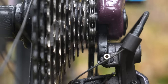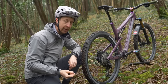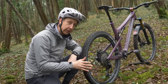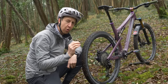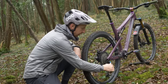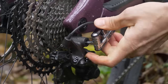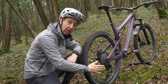That's a good gauge of reference without having to have expensive workshop tools. If it is bent, you will need to bend it back. If you're unsure about this, definitely take it to a bike shop or someone that has a derailleur alignment gauge, especially the tool for doing this. But if you want to do it yourself, an adjustable spanner with the derailleur removed — you can straighten these back, but go very easy on it because you don't want to snap the thing. The next one is to make sure that the actual hanger bolt itself is tight because naturally these can unwind themselves. On bikes that don't have thread lock on them and you've been riding loads of dry, rocky trails for a long time, they can back out slightly. If that's happening, that all affects the alignment of the derailleur.